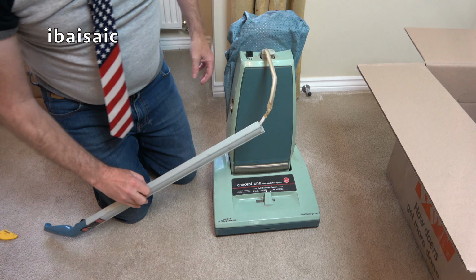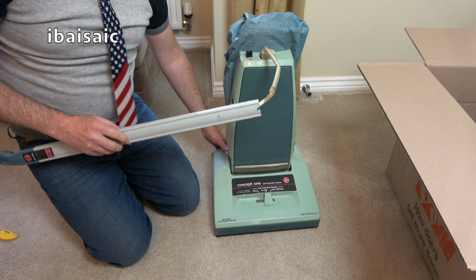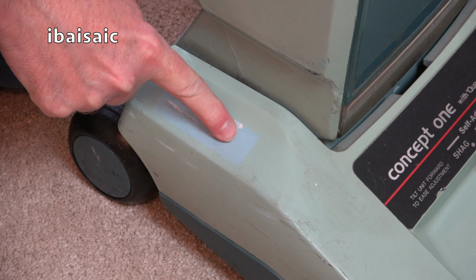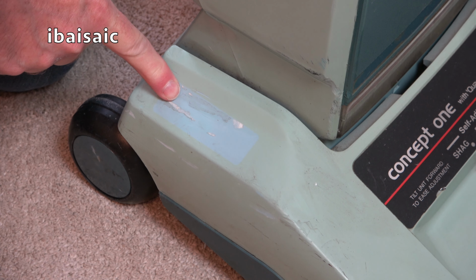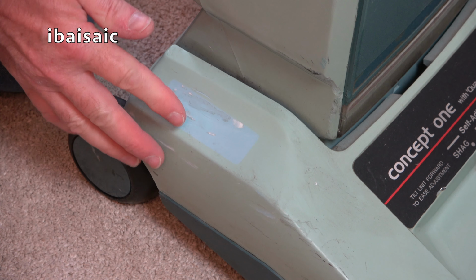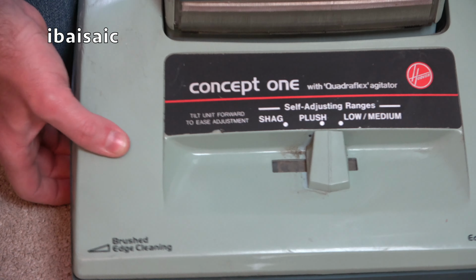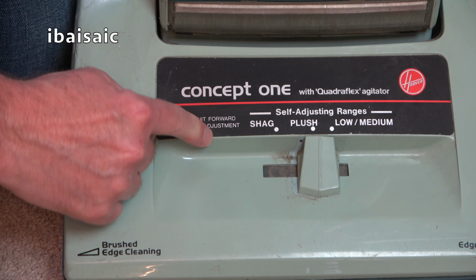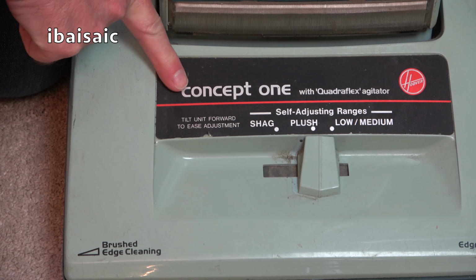Yeah, so far the cleaner looks in reasonable condition, but yes, it's definitely gone a different colour, and we can see the original colour just here. It should be this blue. Now, I've had success recently with retro brighting using an oxygen based stain remover meant for washing clothes, so I'm sure I can get this more blue. The only trouble is, by soaking this in the water, I don't want to risk damaging the decal here. It's already a little bit damaged, but not too bad. But if I was to soak that for any length of time, that might come off.